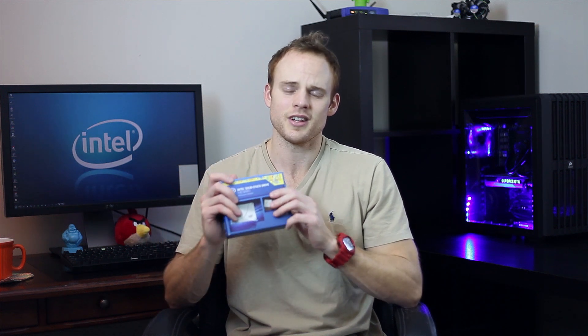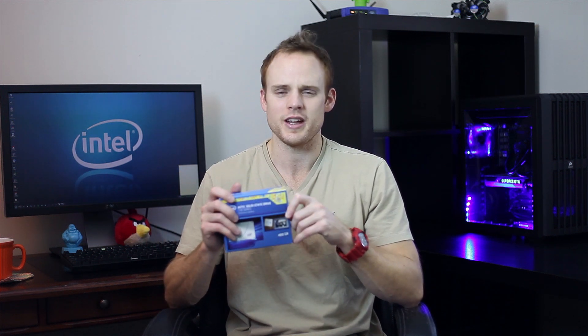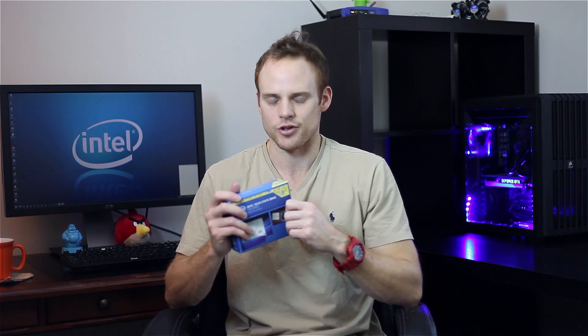The 5 watts power draw is a lot — I would not recommend this for any type of notebook. Most SSDs out there draw 0.1 or 0.3 watts, so 5 watts is a lot when you think about it in terms of a laptop. It also gets very warm. If you check out PCPER's SSD overview on this drive, they go into detail about how warm it gets. It's not really suited for a laptop — this is made for an open design desktop case where it can get some breathing room.